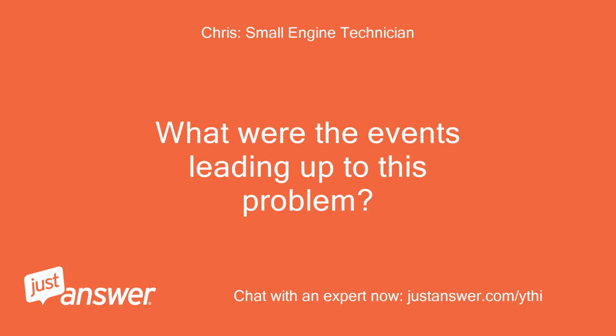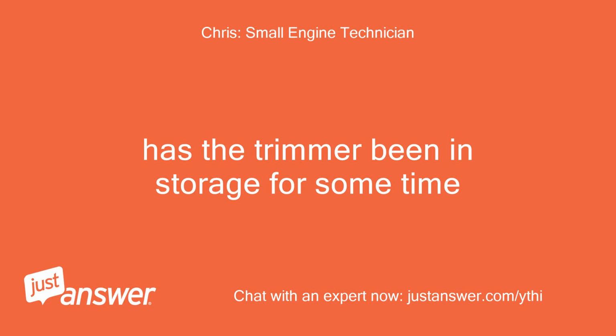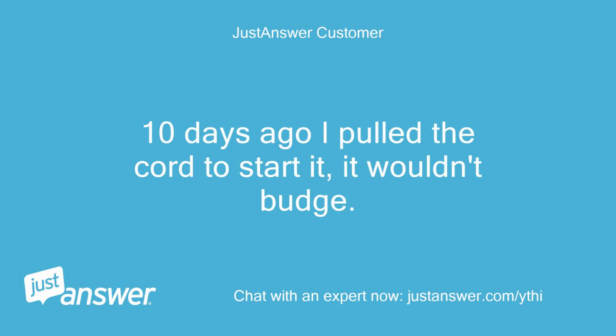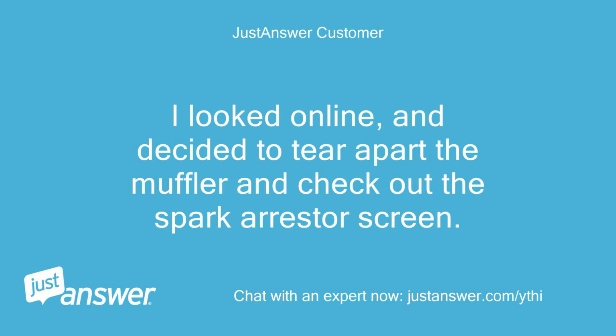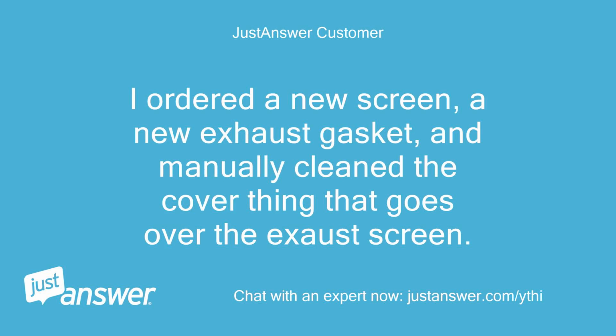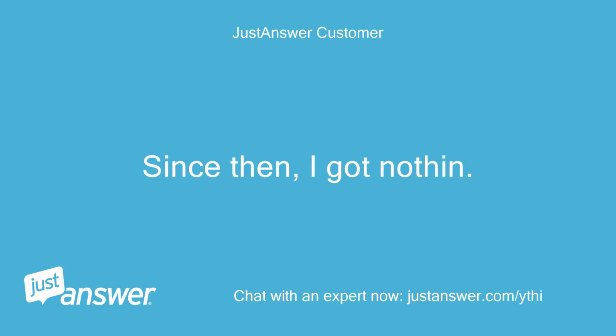What were the events leading up to this problem? Has the trimmer been in storage for some time? Nope. I use it weekly. Ten days ago I pulled the cord to start it, it wouldn't budge. I looked online, and decided to tear apart the muffler and check out the spark arrestor screen. That screen and the cover over it were clogged. I ordered a new screen, a new exhaust gasket, and manually cleaned the cover that goes over the exhaust screen. Since then, I got nothing.